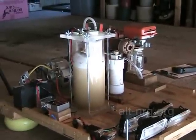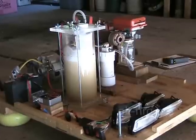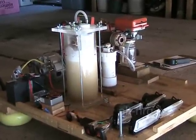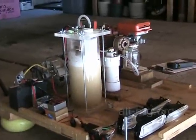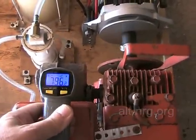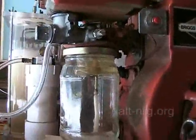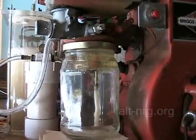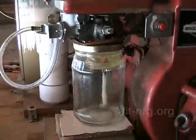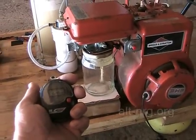At this load the last time I was done one minute from now. This is going to greatly exceed my original run time by a very large margin. I'm going to double check my exhaust gas temperature right now — 785 degrees, 790 degrees. Despite the fact that the fuel bowl is empty, look at the fuel bowl. There's a lot of gas in there still. You can hear it starting to lean out a little bit.